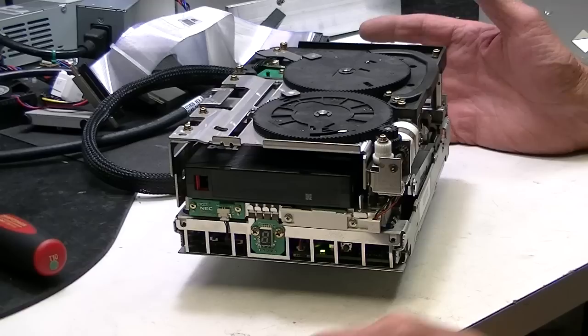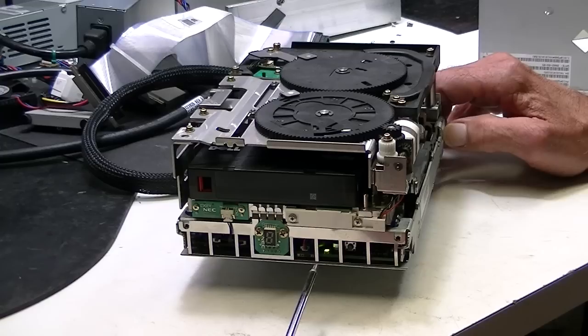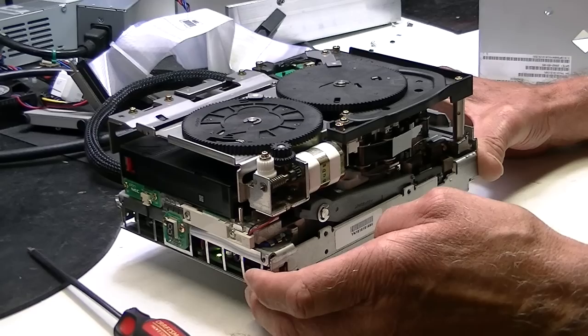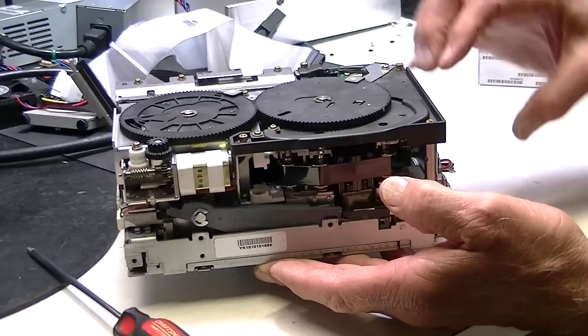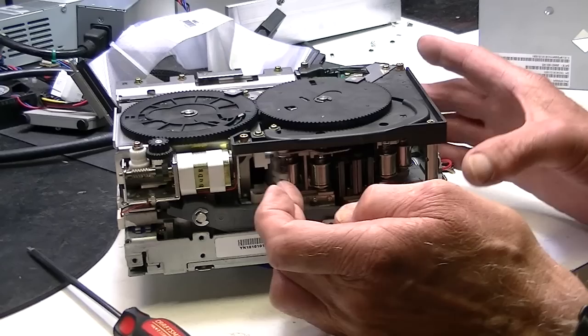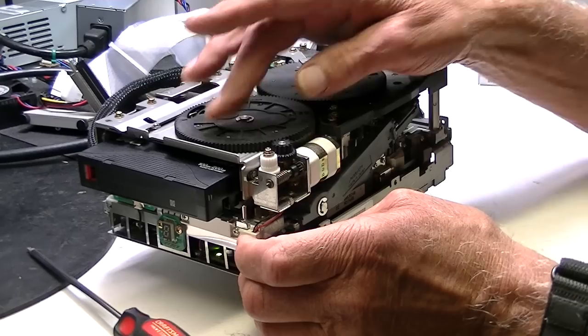When the command is given to the tape drive to eject the tape, I'm going to manually do it — here's the eject button. What happens is commands are processed by the tape drive. It starts spinning the back reel, and as soon as it gets to that junction where the leader pin and leader assembly are exposed so they can come out, it stops there. Then these gears turn, rotate that around, and eject the tape.